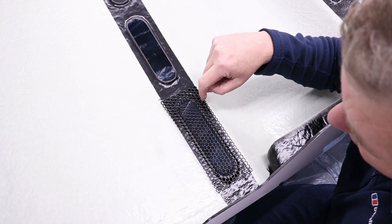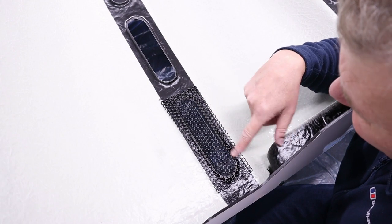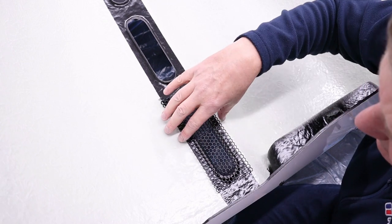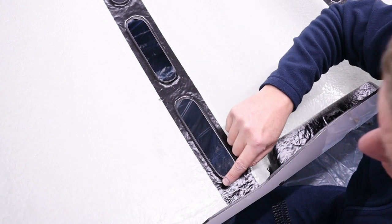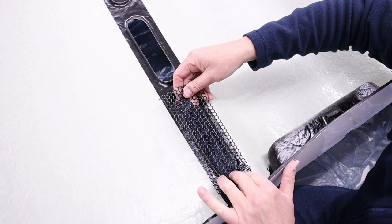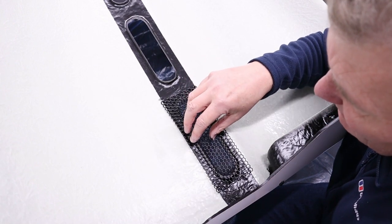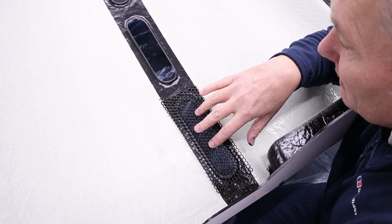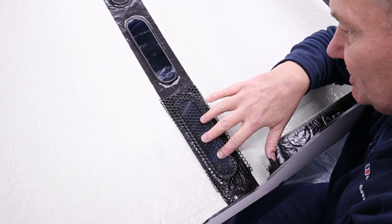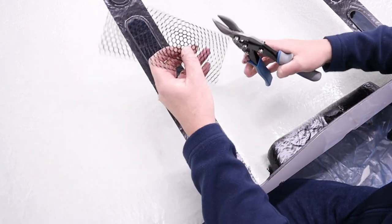What you need to do is make sure that none of the sealant oozes outside. So what I'll probably do, I'm thinking, is I'll trim around here, and I'll take this off, and then I'll put a bed of sealant, just a bead around there, push this down, and then maybe do another bead of sealant over the top. Now, these are usually held in by wires, but I don't think I have to do that here because that just sits in there beautifully. Right, let me just trim this now. So, here's the flow.